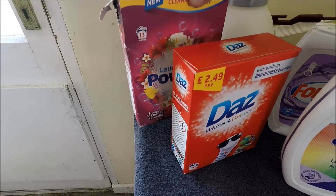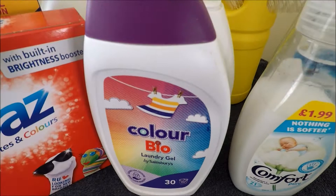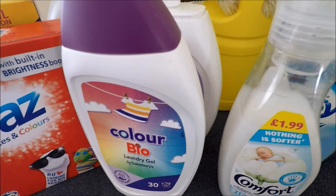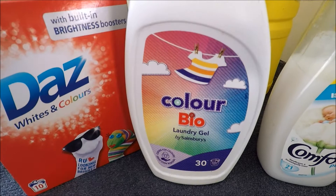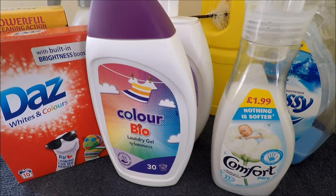The problem with a lot of these liquid detergents being used at low temperatures — something very good for you to be aware of. You're using a 30 or 40 degree wash, however your washing machine isn't breaking down the chemicals within the detergent. And after a while that will become suspended in your machine, causing mold, mildew, pathogens, bacteria.